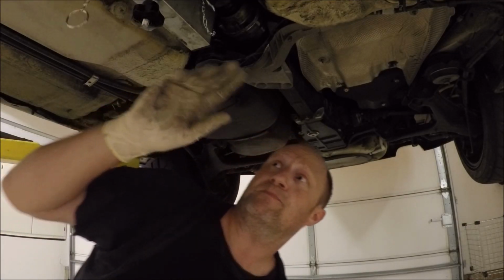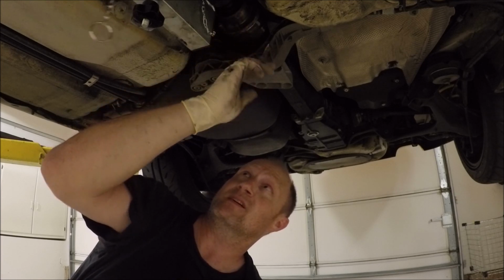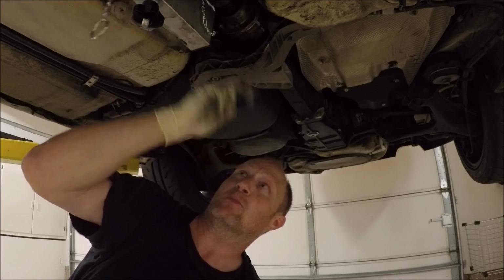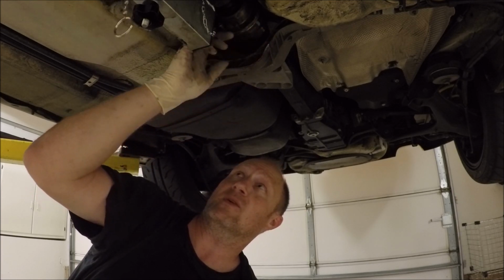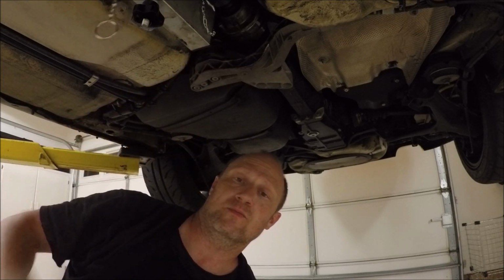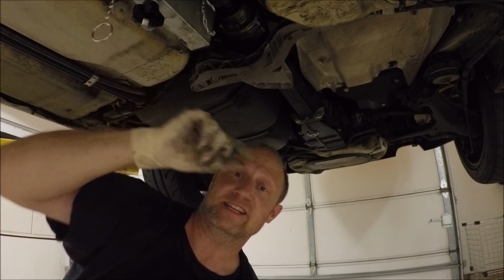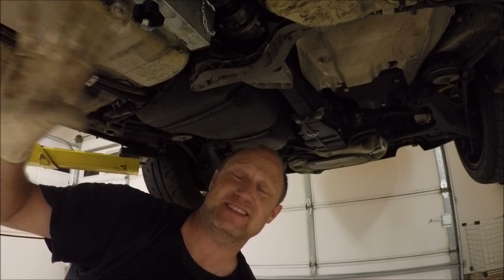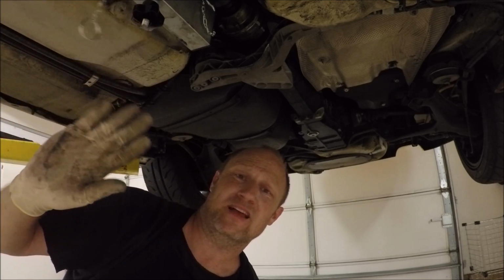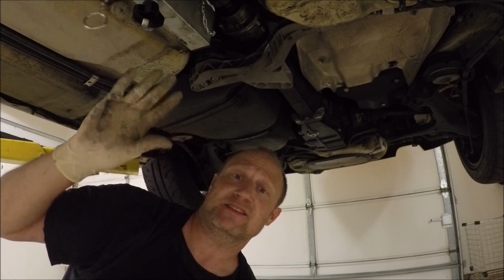Drive shaft is up, pins up. So I have these bolts in here just loose. I'm gonna go ahead and pull this one out and start Loctiting and putting the washer or the lock washer on it with these. I'm just gonna cinch them down, cinch everything down, look at the alignment, make sure everything's good, and then I'm going to then start tightening things up.